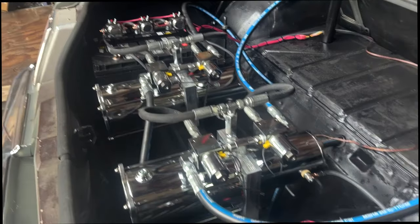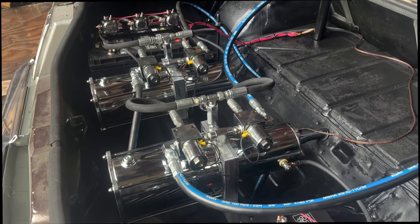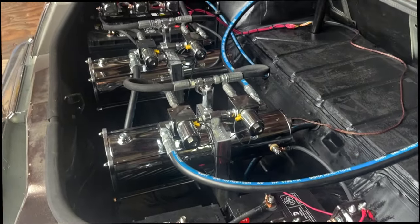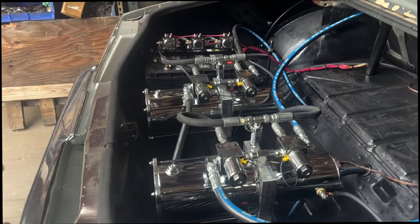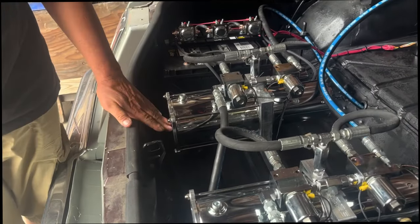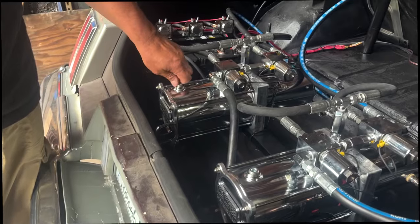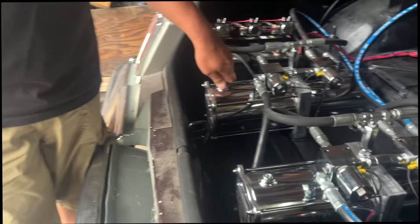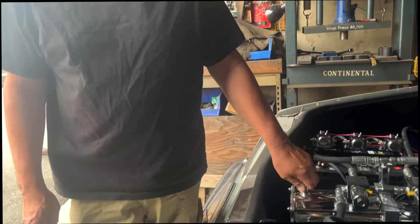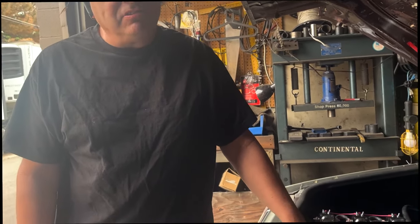So you made a good choice in getting it from Grease Up Front. Because if you ever hear anything or smell anything, I'll show you. You're just going to disconnect real quick. Real important, if your pumps ever sound weird, get the car all the way down, check the oil. Oil level about three-quarters of the way, a little higher, a little lower, it's not going to hurt it. Regular motor oil. It doesn't matter what weight, what brand, or if you mix them. When anybody tells you different, I've had 15 personal cars in my life, I've never seen a difference.